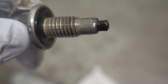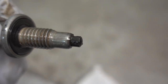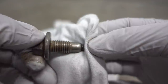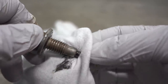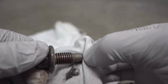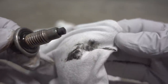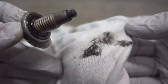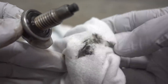If we take a look at my oil drain plug you'll see the end is actually magnetic and it looks relatively dark, so I'm going to go ahead and wipe it on my white rag here and we'll see what that looks like. The magnet itself is darker in color but it does look like — not that there's metal shavings or anything — but it is catching something.